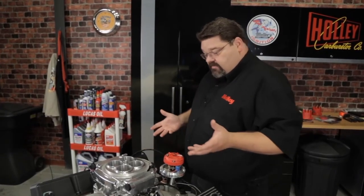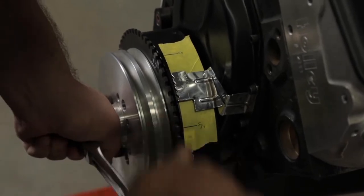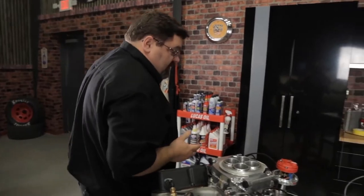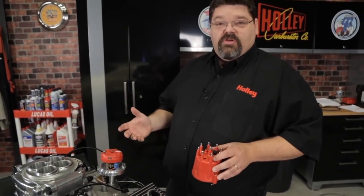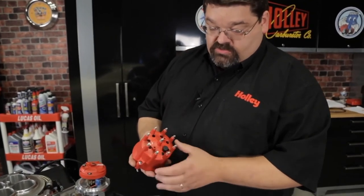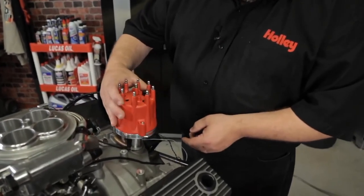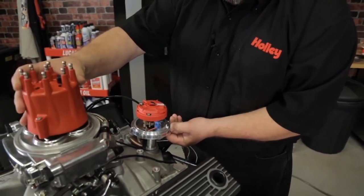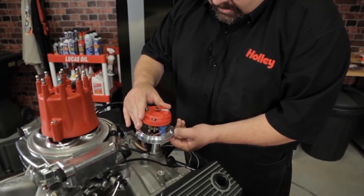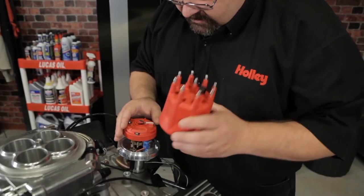Since I'm going to do this at 30 degrees, I'm going to come around to the front of my engine and rotate the crankshaft to my 30 degree mark, which is my midpoint on my timing curve. From here, I need to phase my rotor. I'm going to look at the orientation the rotor is pointing and grab my distributor cap. One handy trick is to take an old distributor cap and drill some ports — some holes — that allow you to view through it; it makes a nice little tool to aid in proper rotor phasing. I'll drop the cap in place, see which tower is closest to that rotor, remove the cap, and make an adjustment to line it up.